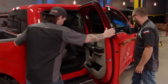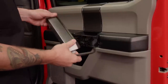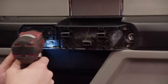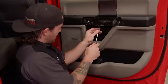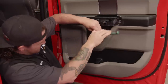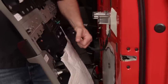Seven or Phillips? Seven pound hammer. Sounds like you're breaking it, but you're not. These plastic panels are actually easy to break if you don't take your time. Two eight millimeters, and make sure to find all the hidden fasteners — like the ones behind this little panel back here. Two clips. Two more eight mils.